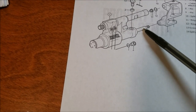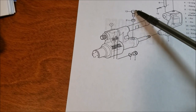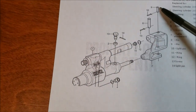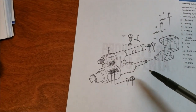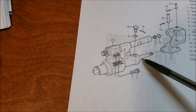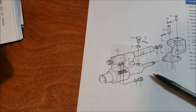The hardest part about this replacement is taking off the cotter pins — there are four of them. One sits here, one at the bottom, one goes here, and one on the bottom unit. Those are fairly difficult to take off. The other difficult part is putting on the o-ring that goes in there, but there's a trick to it and the guys on the forum have a good diagram showing how to do it.